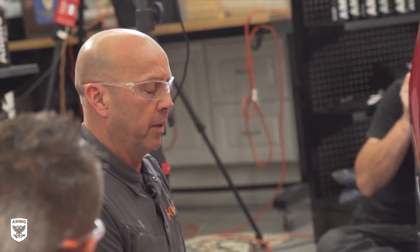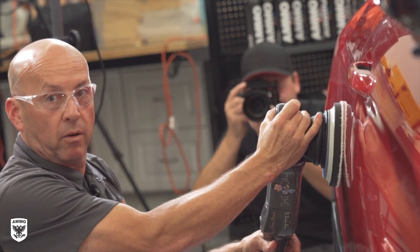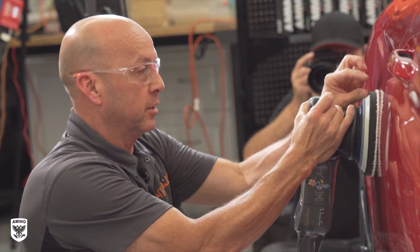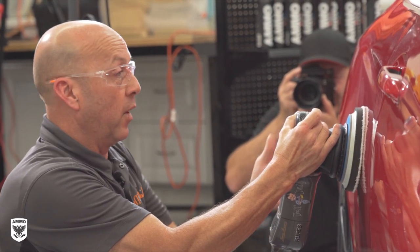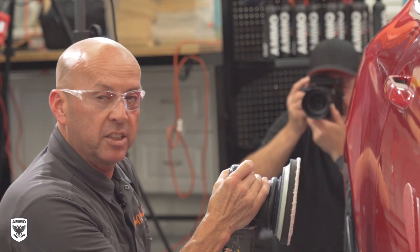Do you think it's old mentality from diminishing abrasives that never went away? It could be. But another problem is, if you do lighten up on the last few passes and unload the pad — if you have the pad planted and then lighten up, it's unplanted, and your speed jumps up. You're not squeegeeing anymore. And if you have a random orbital where the backing plate doesn't fully support the pad, you've got a change of speed, the pattern changes. Anything stuck to those strings not in complete contact is now dragging and scouring. You're basically throwing a curveball in the last second of your polish.